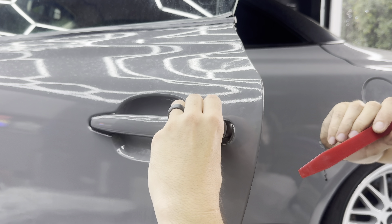Something I forgot to mention: on the grille there are three bolts you have to remove — one right here, two right here, and three right there. Once you remove all of those, pull the bumper off a little bit, disconnect the side marker lights, and disconnect those connectors as well. You've also got the washer reservoir tubing for the headlight cleaners to unplug. Unplug that and now your bumper is fully disconnected.